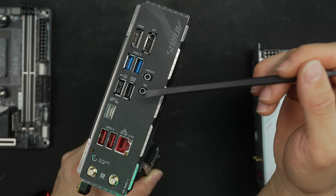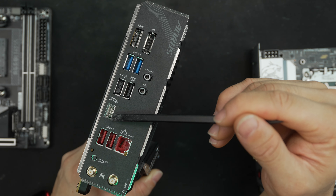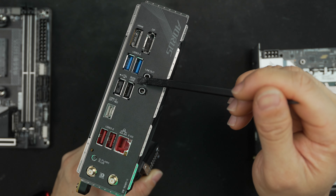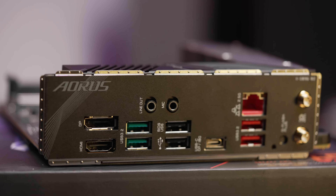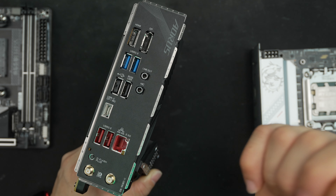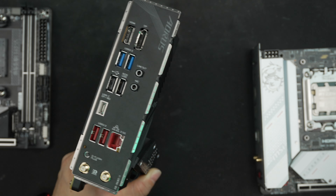At the rear of the board you have four USB 3.2 Gen 1 Type-A ports, two USB 2.0 Type-A ports, and one USB-C — though this is only a 10 Gbps port. One of those 2.0 ports is labeled BIOS USB for Q-Flash updates, and the Q-Flash Plus button is right here below the ports. 2.5G Ethernet and Wi-Fi 6E — pretty standard networking spec for a mid-range board these days. There's also a front panel audio header, which I'll get to later because it's not easy to access. Line out and mic round out the back.